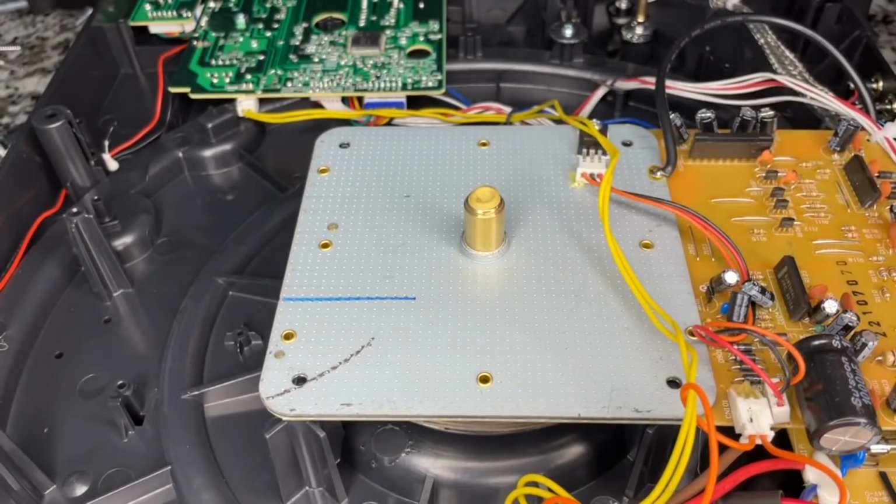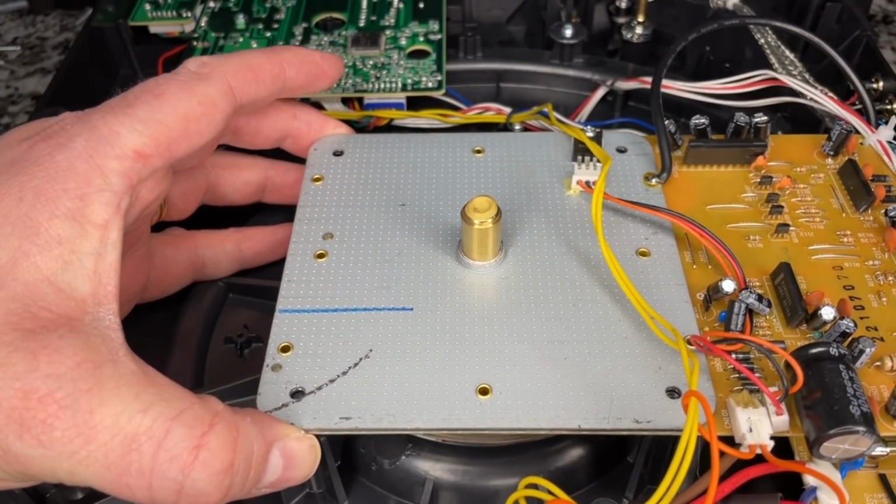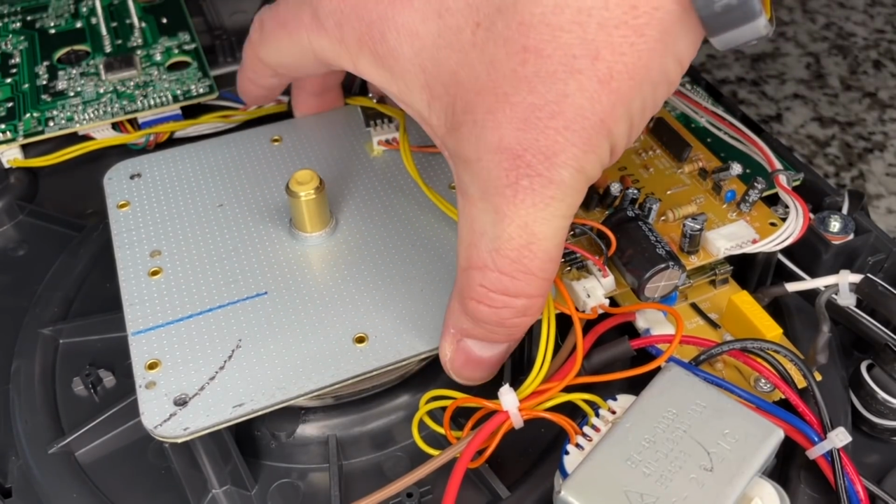Yeah, I think this whole thing is the motor. Okay, I need to take off another screw back here. One of truth, I hope. By the way, don't touch those caps. We had it powered on. And while the voltage may not be that high, you don't want to take a shock. So even after you unplug something, do not touch the capacitors. All right.